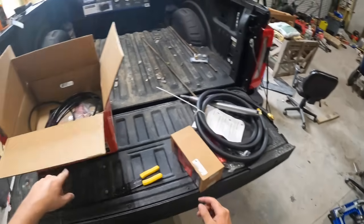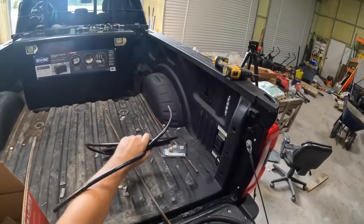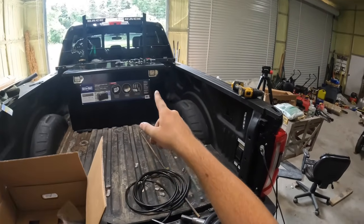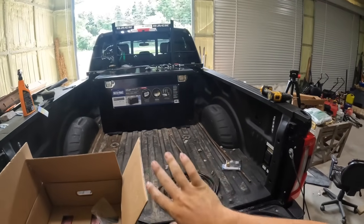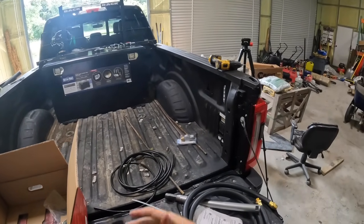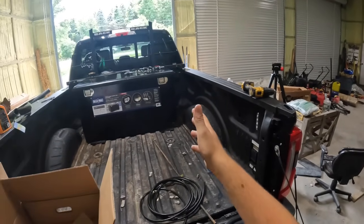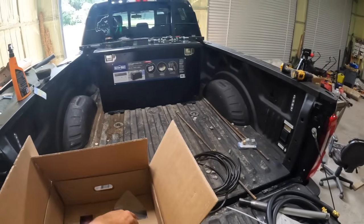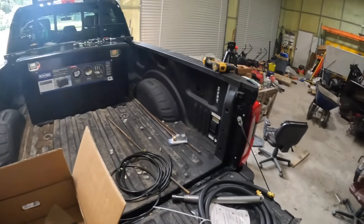It's been a little while since I've set one of these up, but this is our power wire — it's going to go up to the front. I'm actually going to wire this into my aux switches. On my last truck I had issues with people: I would fill the tank and I swear I'd come back and there would be half as much fuel in there. So I'm just going to wire it into the aux switches that way. I don't have to worry about someone coming up, turning the pump on, and stealing fuel. I don't know why someone would do that because you don't know what type of fuel is in these tanks, but whatever.